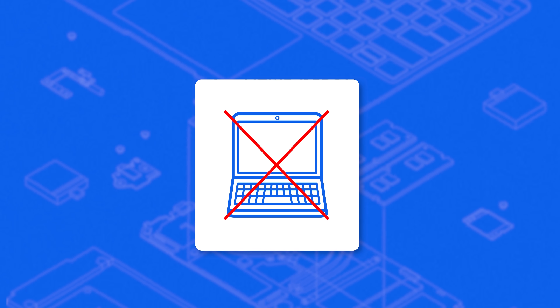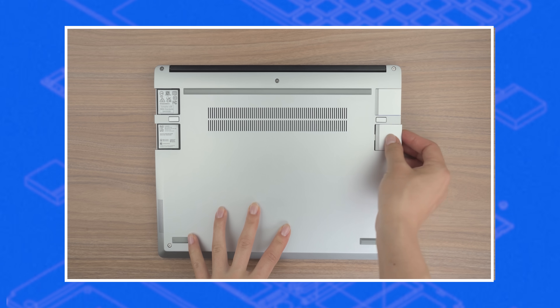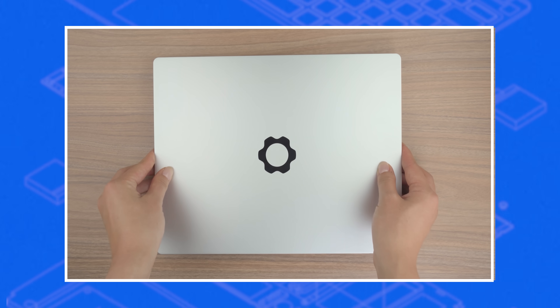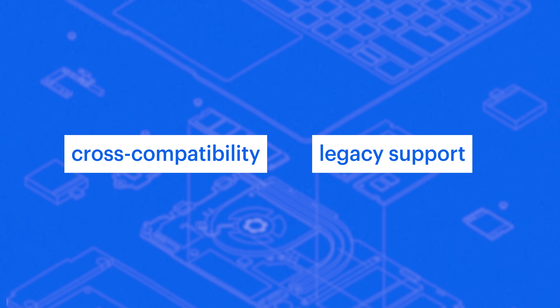But designing for modularity and repairability is different. The goalpost shifts from creating one complete self-contained product to multiple complete products that work without each other, but whose whole is greater than the sum of its parts. Instead of soldering ports onto the mainboard and adding holes to the side of the chassis, the ports now live in their own little self-contained pods that dock into the negative space built into the underside of the laptop. Each IO type is now its own unique discrete product that needs to be designed and manufactured with cross-compatibility and legacy support in mind. This modular design with potentially infinite IO options allows for more consumer agency at the expense of design and engineering complexity. All of the design choices, whether you're designing one product or M plus one products, have to balance user experience with design criteria, design tolerance, and manufacturability.